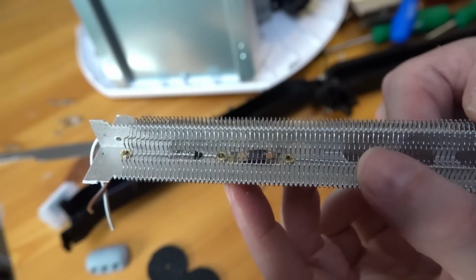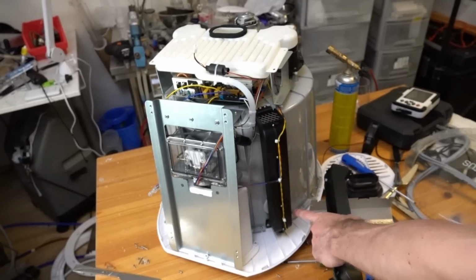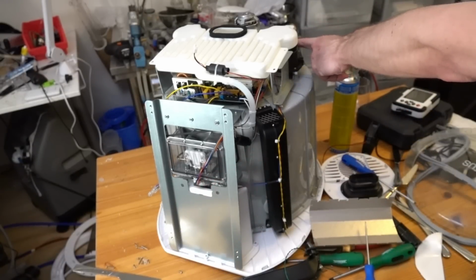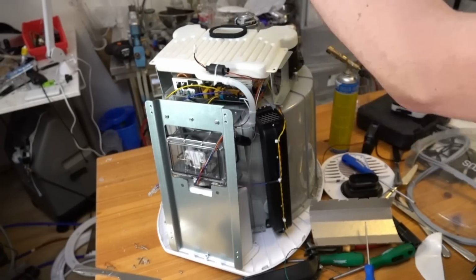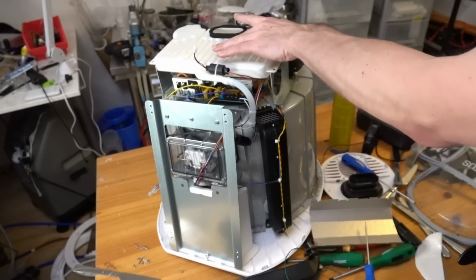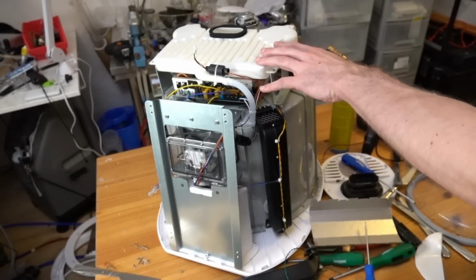Yeah, it's quite nice. So I think the original idea was that they were going to suck the air in from the outside. It was going down the heating elements here, and then it's blown out the little holes at the front there. And then it sucks out the back here, and it goes out from there into this sort of condenser unit where you're getting the hot, moist air coming out here, and you've got the cool air being sucked in from outside here, having the inlet and the outlet right next to each other. Not so smart.